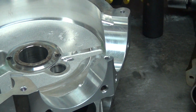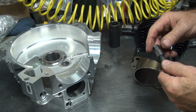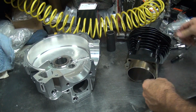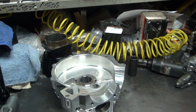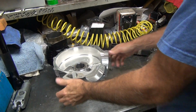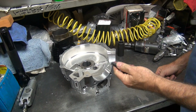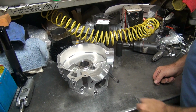And we're not counting any gaskets that'll raise it up. Because right now this nut's bottomed out on the stud. If the nut bottoms out on the stud, the cylinder's still loose. That's bad. Yeah, that won't be good. So our tightening is the thickness of the gasket. Okay, then we got our case. Now studs are oversized and threads are undersized. That's called interference fit.